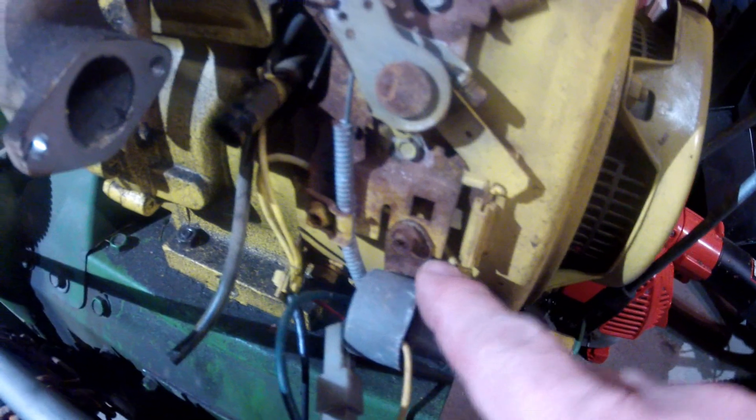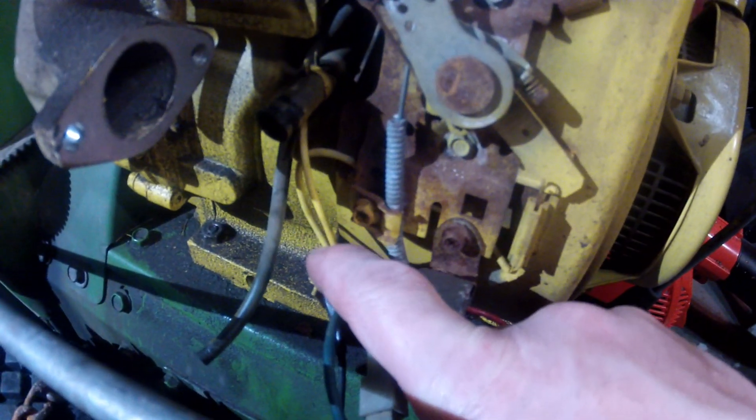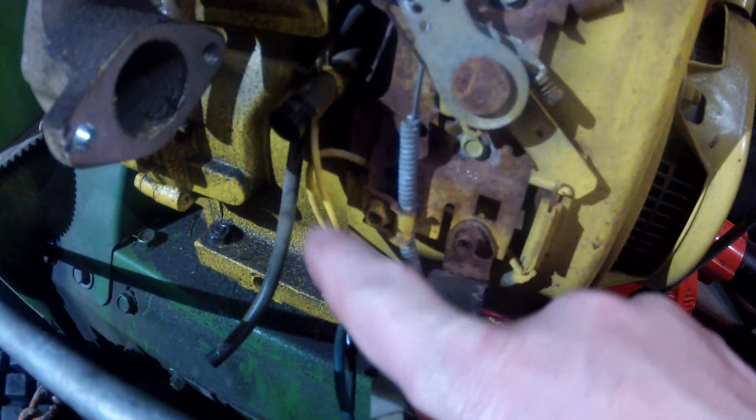That wire goes over here and connects to some other wires which are safety features on the snowblower. All these wires are connected to the ignition coil for the engine. The way you kill or stop an engine is you short it out — by allowing this to slide down and touch this little wire, it basically shorts out the engine and the engine shuts off. That's what that's all about — again, thanks for watching.